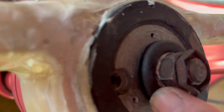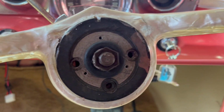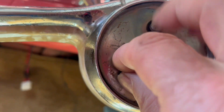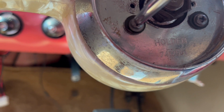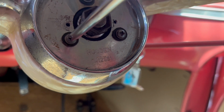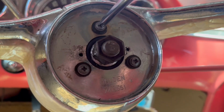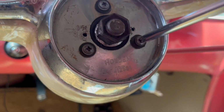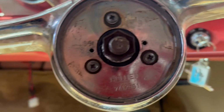Okay, my rubber grommet fitted on the steering wheel shaft there. Okay, now I'll put the ring on. Okay, so the screws, I still need these little insulators because they will still be required. Now we can screw them all the way up, just until they seat. You don't want to over tighten these because they are hard to get. And remember, they're off a bloody 60-year-old car, so who knows what plastics were like during those days.